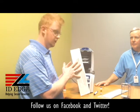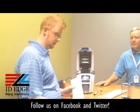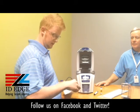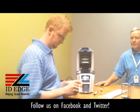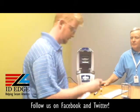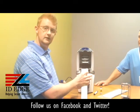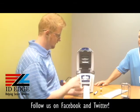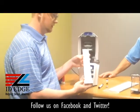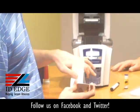You want to open the cleaning cards at the last minute, basically at this 'ready to clean' step. These cards are alcohol-saturated, so the longer they're exposed to air, the more they'll dry out. Go ahead and open those now, throw the cover away. If you look at the card, one side is skinny and the other side is shaped like a T. You'll want to insert the skinny side into the front slot — the function of the thicker end is to get stuck on the outside of the printer to help clean the rollers.